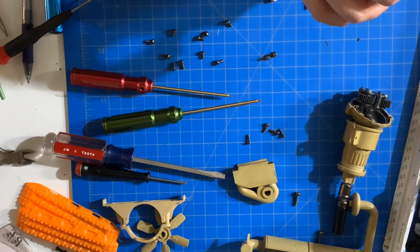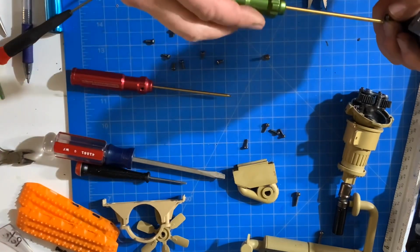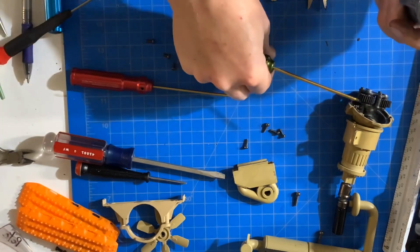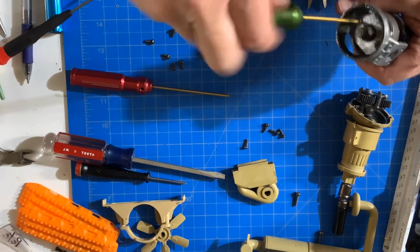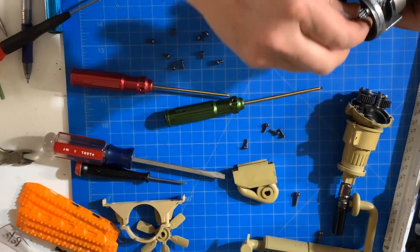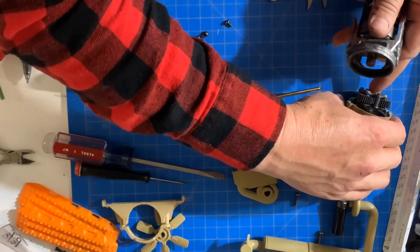So I slowly removed some material using the grinding wheel on the Dremel to allow me to get that pinion to fit on there. And then I got the pinion set at that 19 millimeters, and I'm mounting the motor mount. Motor mount screws back in. Nice and tight. Gear reduction upon gear reduction. I like it.